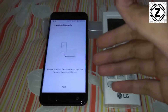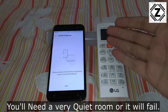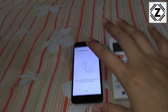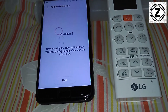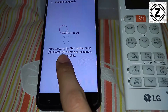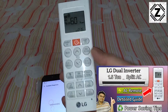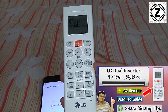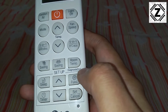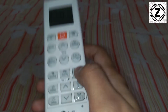But actually, this technology is pretty strong. If you have a quiet environment, you can be sitting on your bed and it can work from there too. Let's try it out and see if this phone is able to get all those audio frequencies from roughly 20 feet away. Now here the sequence is very important. After pressing the next button, you must press the diagnosis button on the remote for five seconds. This is my latest 2021 model remote. The Smart Diagnosis button is merged with the room temperature button. After hitting next, you have to very quickly press this button for five seconds.